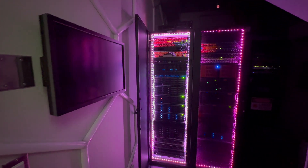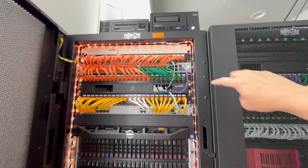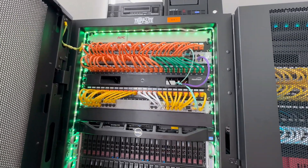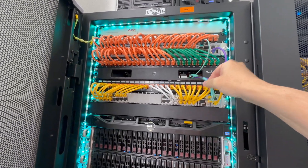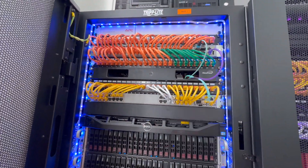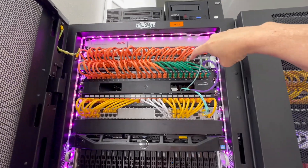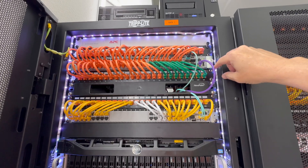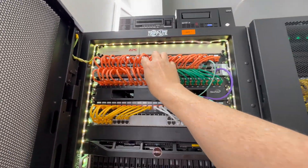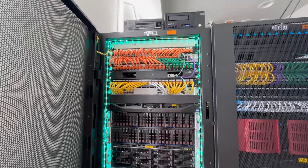Starting on the server cabinets — this is primarily some storage arrays. Here I did the keystone-based patch panels, above and below the switch with the little six-inch jumper cables. I do have one rear pass-through for some fiber connections from the network rack and another one for this switch. I'm using orange keystones because these are all 10-gig networks. Overall it makes for a pretty neat and simple-looking layout. For a 48-port switch, a six-inch cable still reaches. If you end up buying smaller switches with fewer ports all in the center, you might need slightly longer cables. Color coding makes it easy to indicate different networks.